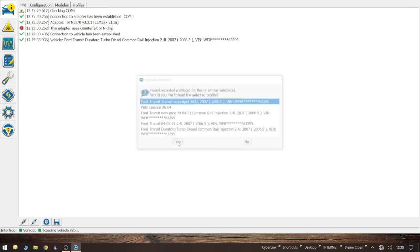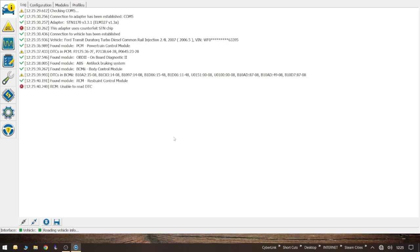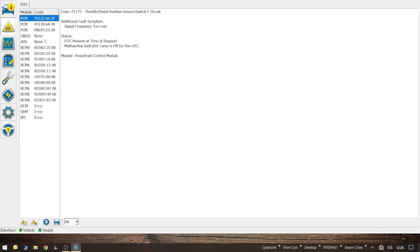The bloody microphone on the laptop failed to work, so I'm having to do a voiceover now. I'm just showing you here how the system's loading up - it's running through a scan check. This is like an OBD port reader and it'll give you all the error codes. A normal hand scanner will tell you what's wrong but it won't tell you how to put it right. This program is worth the little extra to plug into your laptop. There are all the codes that have gone wrong - all because of this ABS master cylinder.